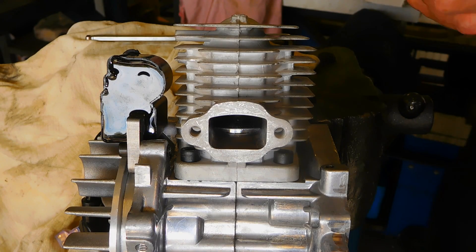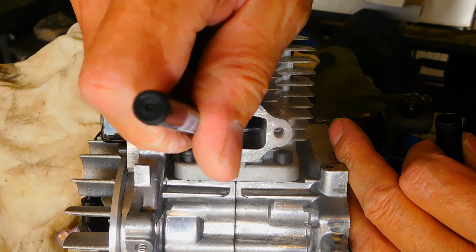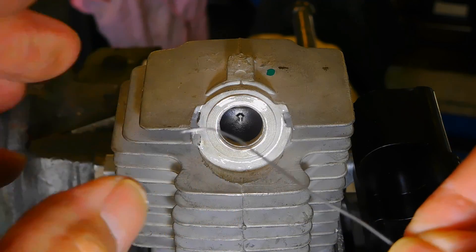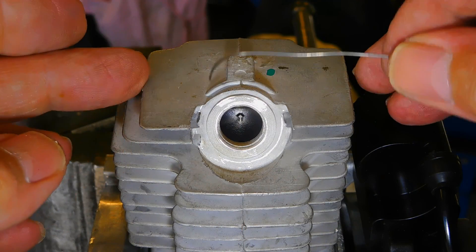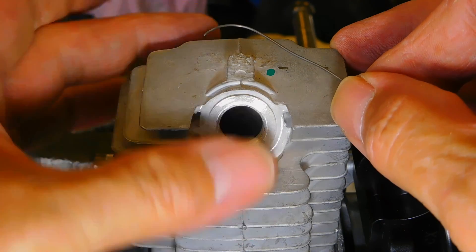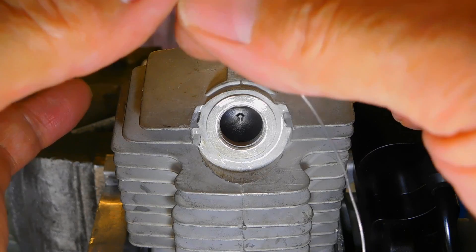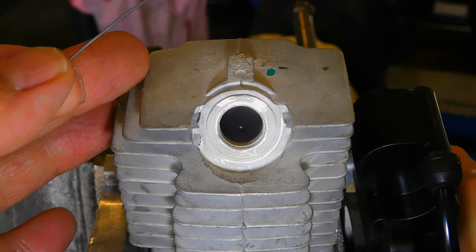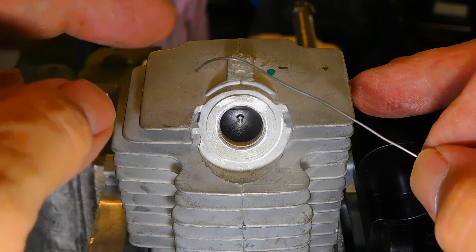What we've also got with this motor is the piston doesn't go all the way down. Before I take it apart, I'm actually going to use a marker and mark the piston. I've got a piece of solder here — you can use a thicker piece of solder, or you can use it to squish against the top of the cylinder, because we haven't got a removable cylinder head. Normally if you're going to measure the clearance, you want to lay it all the way around the cylinder and all the way around the piston. If you just measure on one side, the piston can kick over and give you a false reading. Put at least two pieces — one side and the other side, or all the way around the piston — not on top dead centre. Just put a ring of solder around the cylinder so that when you bring it up to top dead centre and squish the solder, you can measure it in a couple of places and get the average clearance across the cylinder.